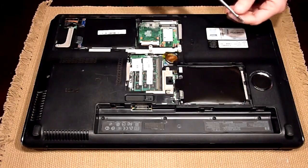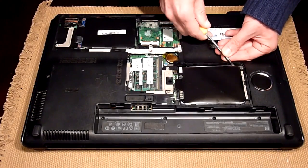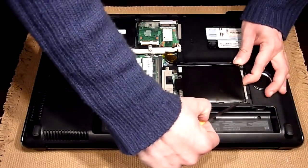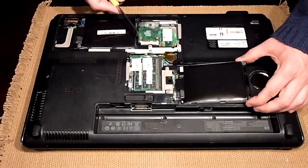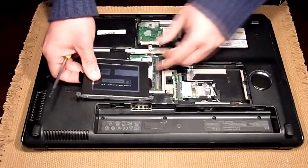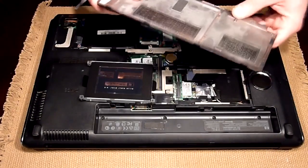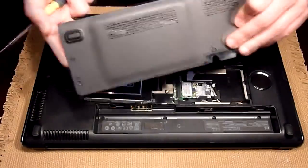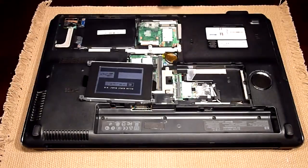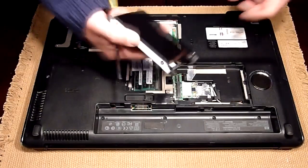What you need to do is take a flat screwdriver and just insert it on the side of the drive here, on the other side, and once it's lifted up, just pull gently and here you go. You can remove your drive — no screws, no nothing. And by the way, the screws cannot fall from the cover lid, so no worry about losing the tiny screws. So now I'm going to show you how to install the drive caddy.